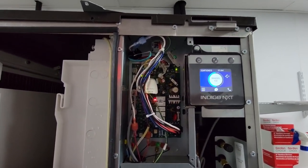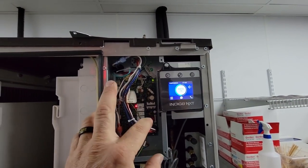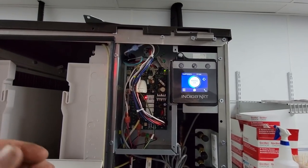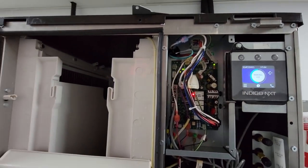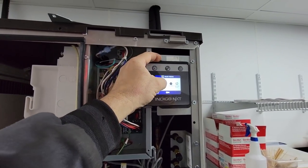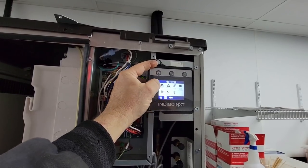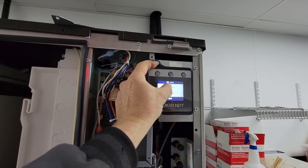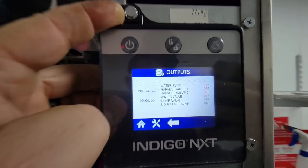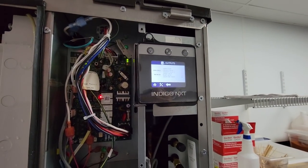It's kind of similar to how I used to override the old ones — basically stop, clean, stop, clean two or three times and it would get them out of it. Anyhow, this is starting to go into freeze mode now. I still don't know my way around this thing very well, but there's real-time data. Liquid line valve is on, so we're starting to freeze down — we're in our pre-chill. It should be starting to freeze down here real quick.